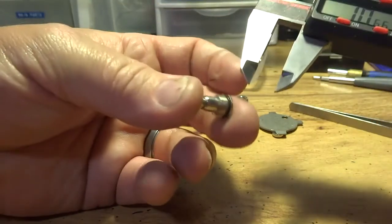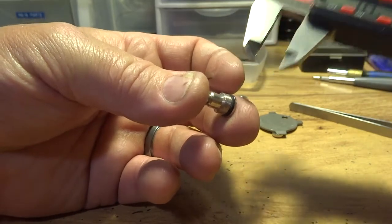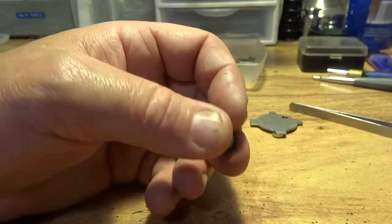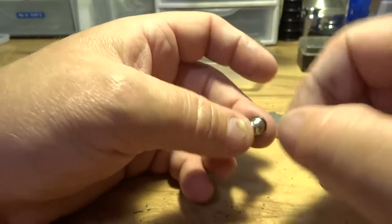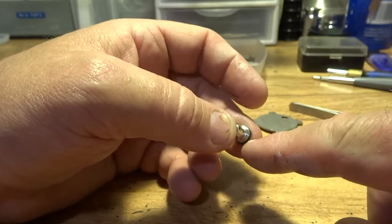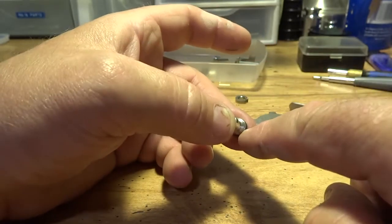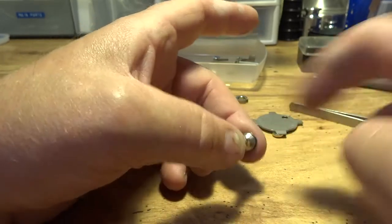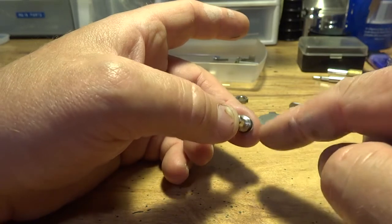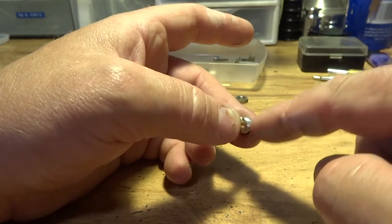Yeah, just go 8 exterior by a 1 millimeter diameter of your cord. So that'd be like an 8 by 1. What that basically means, if you've got an 8 by 1, it's 8 millimeters across by 1, which you take times 2, because you've got this side and this side. So you've got 8, which means you're going to have a 6 millimeter internal hole on the O-ring.